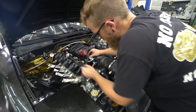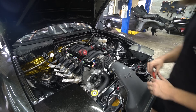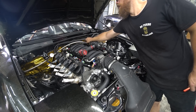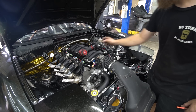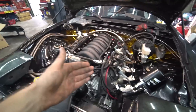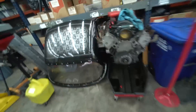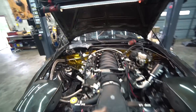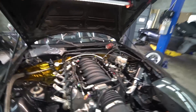I put this line on with this already in here, so I have to take this line off. Normally I run this under but then it gets caught on the water pump pulley, so for now I'm going to leave it like that. One thing I do need to do is go ahead and pull these valve covers off, pull these coil packs off, and swap all my old valve covers and old coil packs for my dry sump breather - just to get us by through this event. That way I have the breather set up already on there. If you're wondering why we have 101 Dalmatian valve covers, it's because this engine with the rectangle port heads, the rocker arms are not evenly spaced. So the moral of the story is it wouldn't fit. I had to use one of the stock valve covers I got with this engine for this side - the one that did fit is the one with the AN fitting that I needed for my breather line. So we're good. We'll have to tackle that project later and plan out the best spot to put that line - I don't want to rush through it. This will get us by.